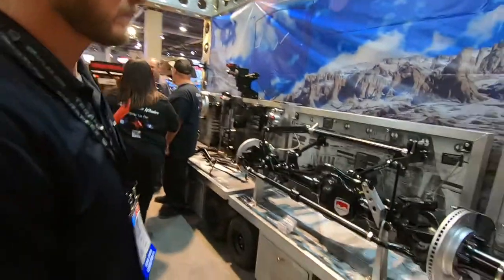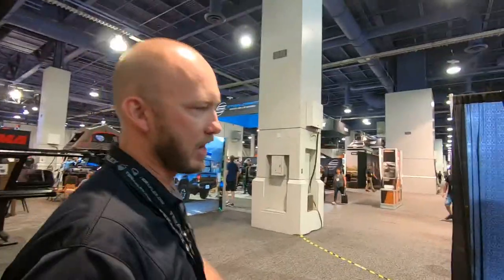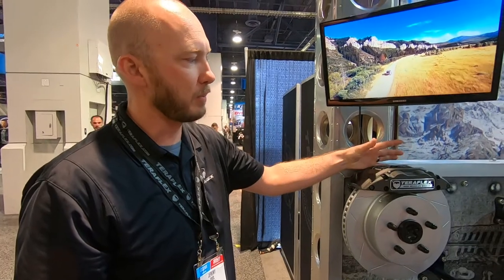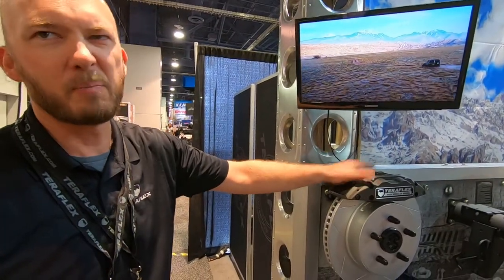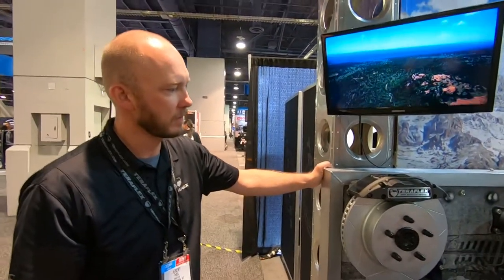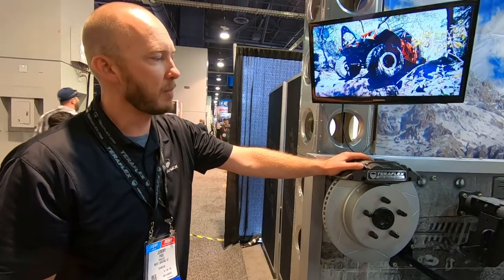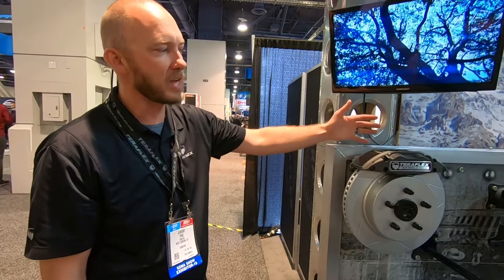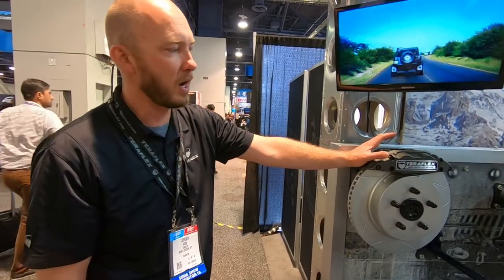It's definitely one of the beefiest setups I've seen. The delta brake is clear down on the far end here. Is this built specific for the JL? It will work for the JK and the JL. This delta brake uses a 14-inch rotor front and rear, and a four-piston caliper. It completely changes the way the caliper works — you can change the brake pads without removing the entire caliper from the axle. We were working on this back before the JL even came out, originally for the JK, but it works even better on the JL. It's now out and available on the market — front and rear total replacement. Retail price is $2,300.